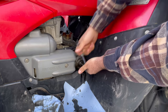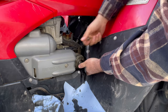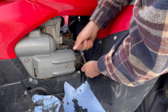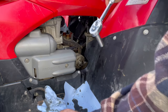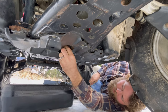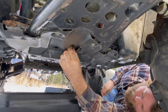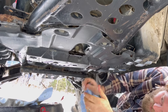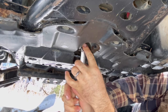Once we get this all changed I'll start it up, take it for a ride, make sure everything else is good on the machine, and see what it needs before getting hold of the owner. Seat the filter in there — it doesn't require a lot of torque, just a little bit. Now hop back down and put the drain plug back in. Start it by hand — you never want to cross-thread these things. Tighten until the crush washer seals; it doesn't take a lot of pressure and we don't want to strip it out.